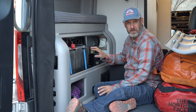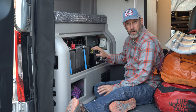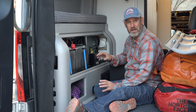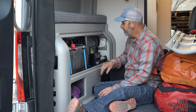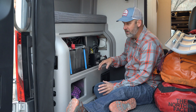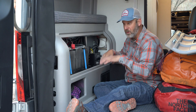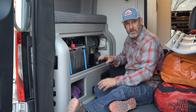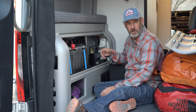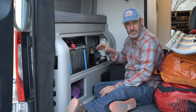If we return to our van and it is really cold — meaning zero degrees — and we find that our batteries are zapped from the cold, we are going to have to manually warm our batteries. It needs to be above zero degrees for these battery warming blankets to operate. If it's below zero, we are going to need to get in here with a space heater plugged into another power source, or park our vehicle in a warm building — we have to do something to warm these batteries to get them to accept a charge and work.